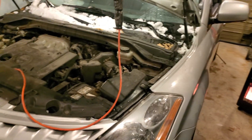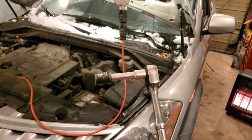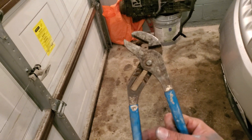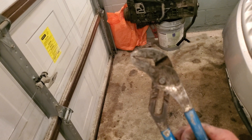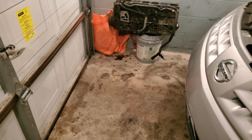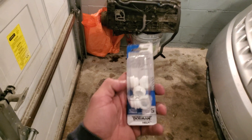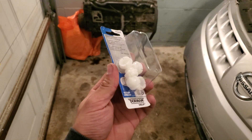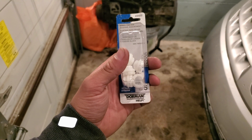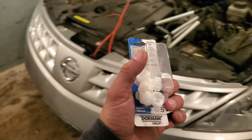The tools we're going to be needing for this job are a trim tool or flathead screwdriver, a hammer, a ratchet, an extension, and a 14 mil. You'll also need a small pair of channel locks and possibly a larger pair of channel locks that are slightly offset to grab the bushing when installing the new one. We're also going to need a 10 mil socket. As for the part, this is a Dorman product — part number DOR49452. That's the part number you'd need to fix this.